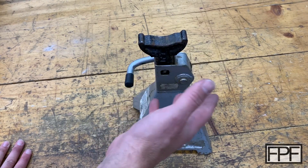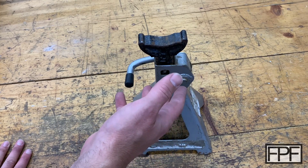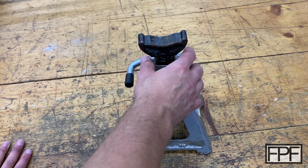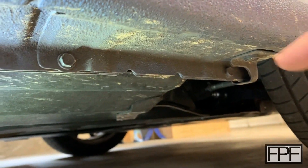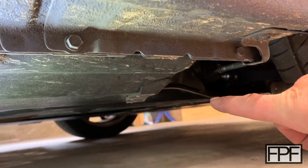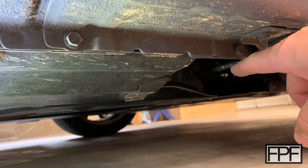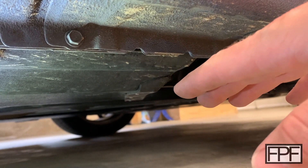I thought there's got to be a better way to do this. I looked online and I see these pads that you can put on top of a jack stand to support the pinch weld, but I wasn't sure if that was going to work. So I thought the best thing to do is actually just get the factory jack, get underneath the car, and see how it works. Here we are underneath the front of the car — that's the front tire, and this is the pinch weld. There are two indentations and you center the jack between them. The manual tells you that's the jacking point, but we're going to see that's a little misleading.